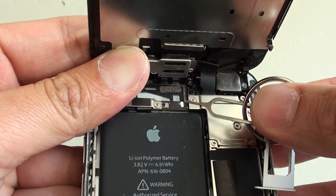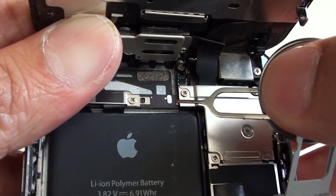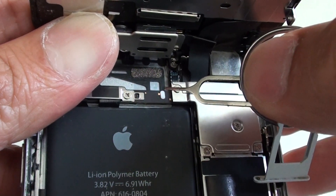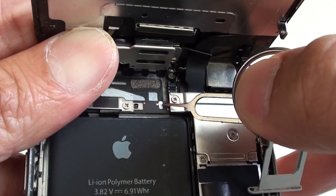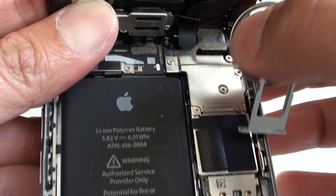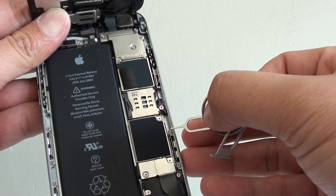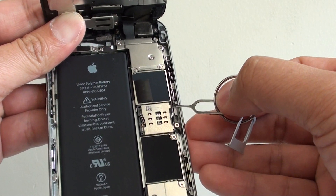Another one is at the top of the board here. You can see there is a white sticker — that one is a water indicator. If you spray a bit of water on top of this, you can see it will immediately turn to a red color. Those are the two main indicators you can easily spot: one at the top and one on the side.